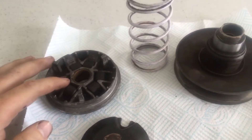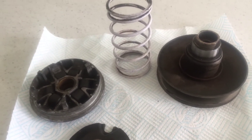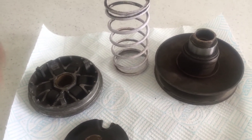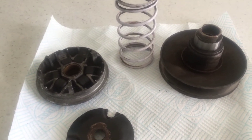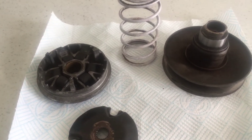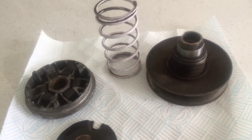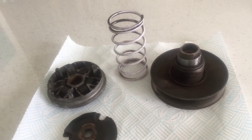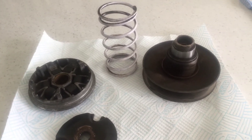The roller's job is to hold the revs at a certain RPM. If you go really light it will rev more, but if your cylinder, exhaust, and setup doesn't create the most power at that RPM, you'll be revving to 9,000–10,000, basically wearing out your cylinder and crank, using more fuel and getting less power — because the peak power could be at 9,000.